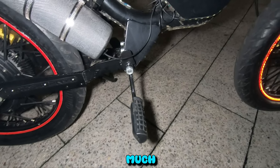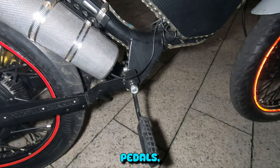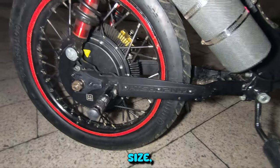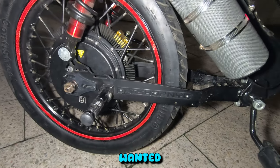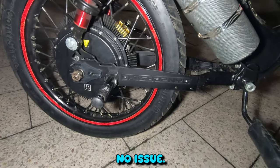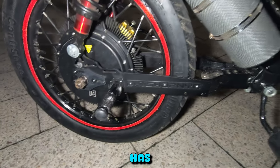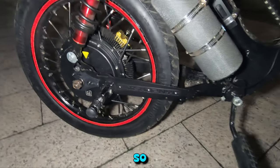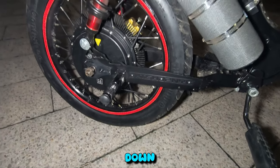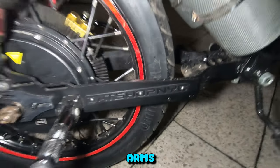I am rocking the Dat Shop swing arm — the standard size. I went with standard because I wanted something I can still bring into my apartment and go through traffic with no issue. I'm running 67 to almost 70 mph, and this standard swing arm has been keeping my wheel planted really well. I'm only running 530 phase amps, so I'm not crazy torquey but pretty torquey. I would definitely suggest upgrading your swing arm if you want a stable ride.